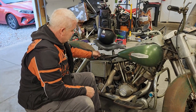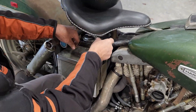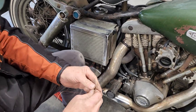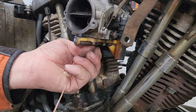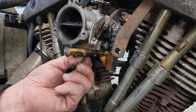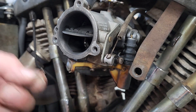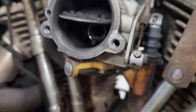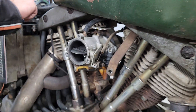My matchstick is right here — I've got a piece of copper wire that I wrap around my frame. So when that thing sets for a while, I take that piece of copper wire off, put it down in there, and find that hole. The bottom of this thing is plastic, by the way. I find that hole and push on it — you can hear it sloshing gas in. That puts the gas into the carburetor. Then it lubricates that diaphragm and you can take off and run.